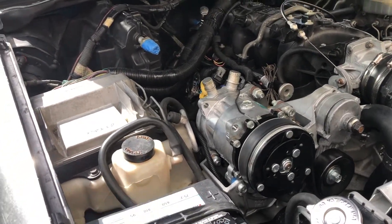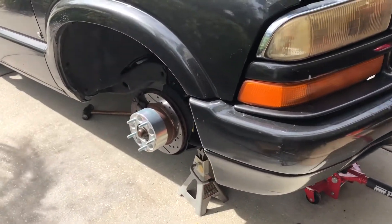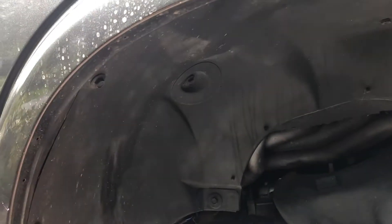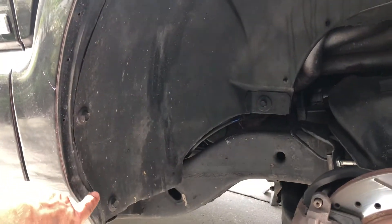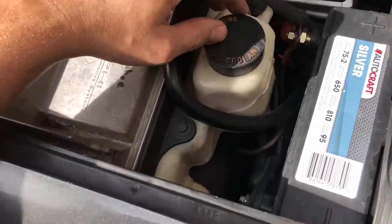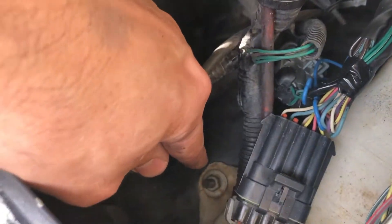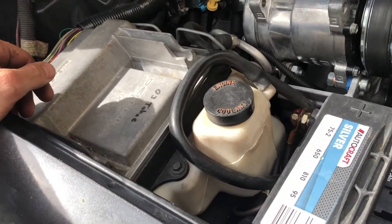The first thing I'm doing here is I've got the truck up in the air on jack stands — being safe, all that good stuff. I've read up on the subject and it seems the first step is to take out this inner fender well right here. I'm going to go ahead and remove that. Pretty straightforward — there are 13mm bolts right here on these bolts. The overflow tank might be bolted to it — yes, right there. And back here in the back there's also another bolt. I think those are the only two, so you're going to have to pop those two bolts off before you pop that fender off.